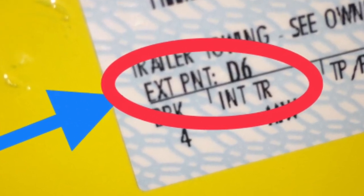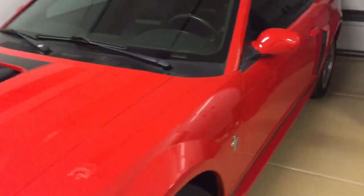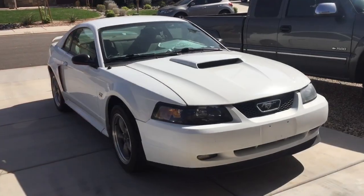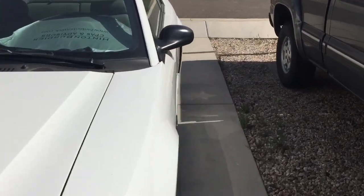That's where it's found - that bottom left corner of the sticker. Here for example is my Mach 1, which is torch red. Same thing - you go into the door jamb, find the corner of the sticker, and there is D3, the code for torch red, which is also Colorado red. It's actually kind of a tricky one.